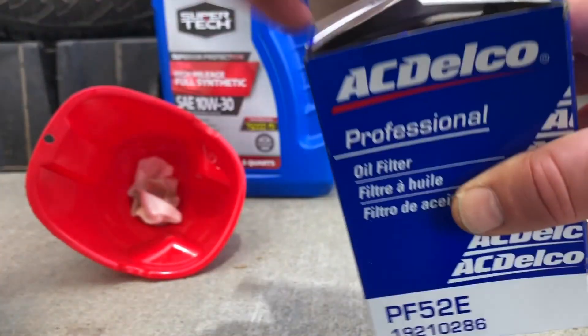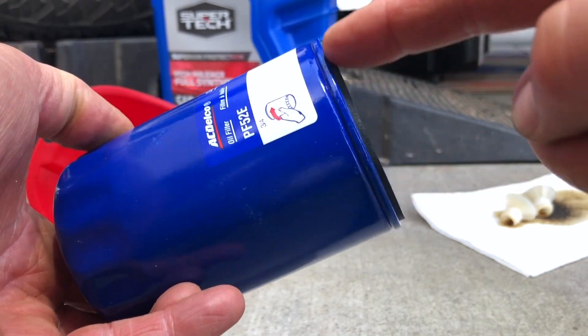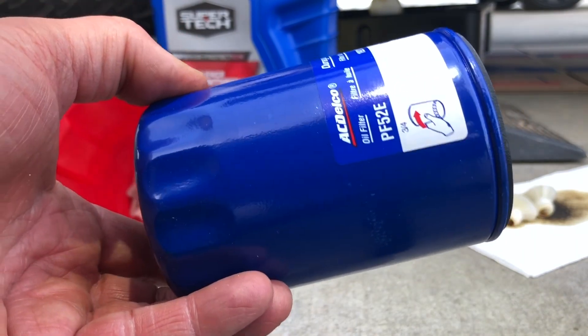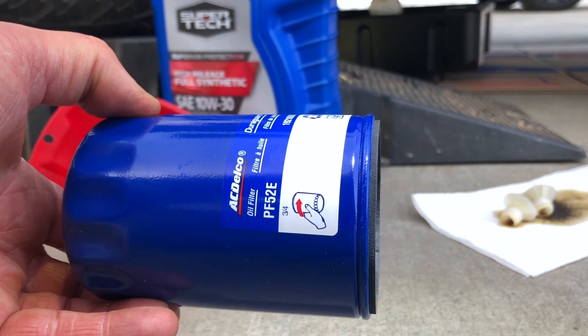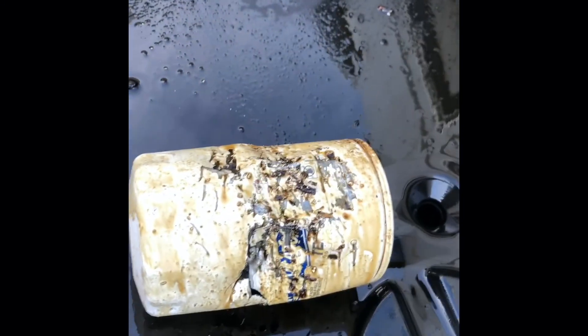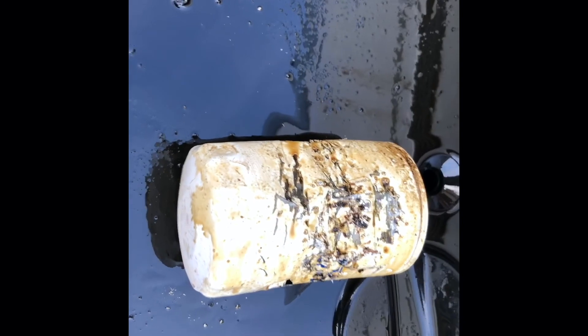We're going to take this filter out. One thing we want to do is put a little bit of grease just around that ring so it really seats nicely. Make sure it's nice and dry and clean so you can tighten it up good. When you're changing your oil, you just want to snug it down — do not over-tighten this. This is what can happen when the oil filter is in a really bad location: I wasn't able to use my oil filter wrench and had to use a gnarly pair of pliers to grab it, and I absolutely shredded it.